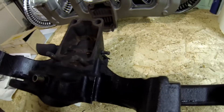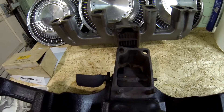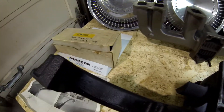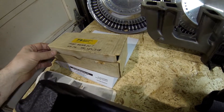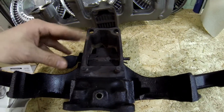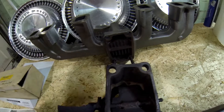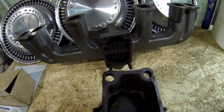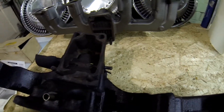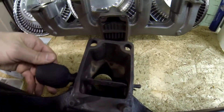Mine is not working. I'm missing some parts off the end, so I found that Kennedy American had a kit and I ordered that up. Now I have it and I'm very excited. It's a new old stock box — great to get a 40 year old part kit. So what this does: when it's cold enough it redirects the exhaust air up against a heater plate in the intake manifold, warms the vapors, so on cold mornings it gets the car started faster, until the engine compartment temperature rises enough for it to close off again, at which point it just directs the vapors straight down into the pipe.